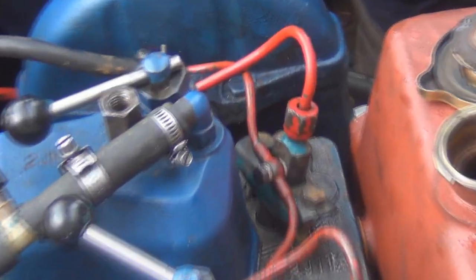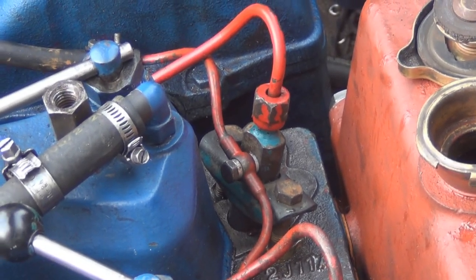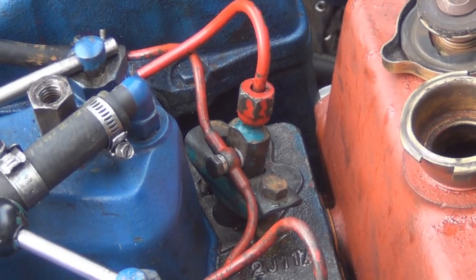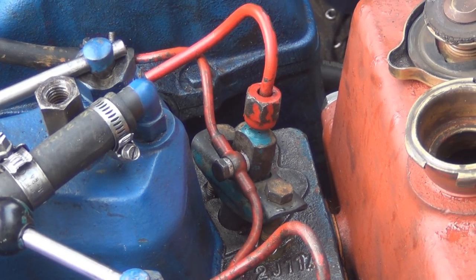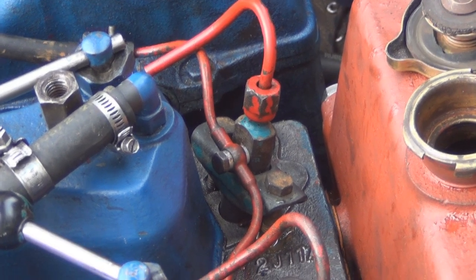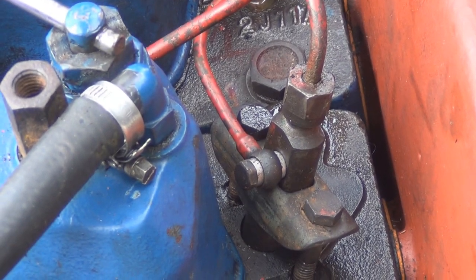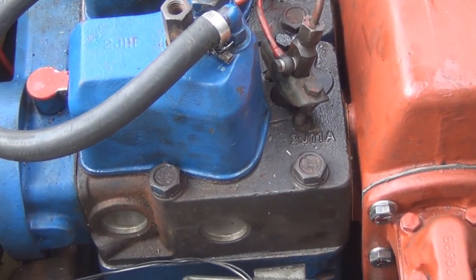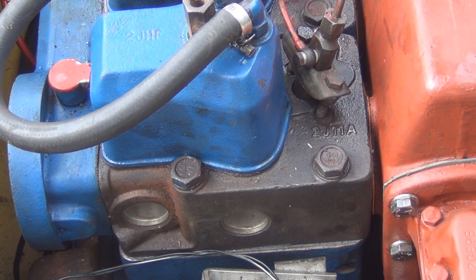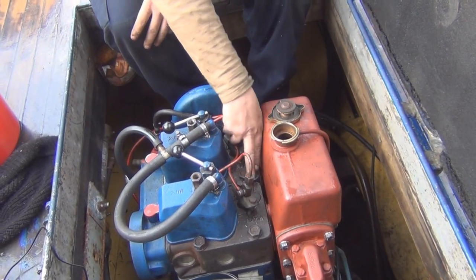Tensioning the clamps - how do you do that? Is it just as far as they'll go, or do you feel it? Is there a torque measurement? There is a torque setting on it. I think it's around about 14 pounds, which is not an awful lot. What's the head? The head was torqued to - no, it was a massive amount, I think it was about 114 pounds. And they're done in sequence, so you go crosswise.